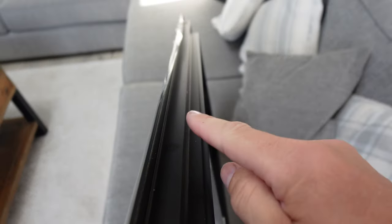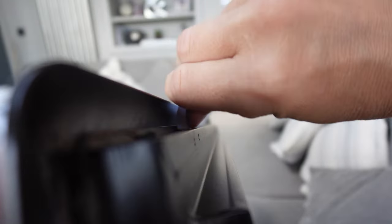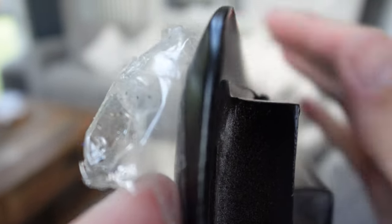Now the problem that we're going to have — and I've been avoiding doing this — is if you look, if you imagine the skin of the van is going to have the hole cut into it, this section here goes inside the van, so it will flush up to the metal. But there's actually a big gap behind my finger. So if I put too much sealant on, it's going to ooze out, and if I don't put enough on, it's not going to touch the van and seal it. That is the dilemma we are faced with this morning.